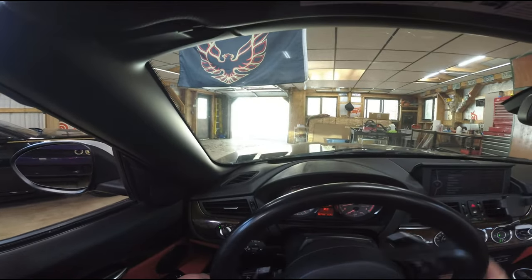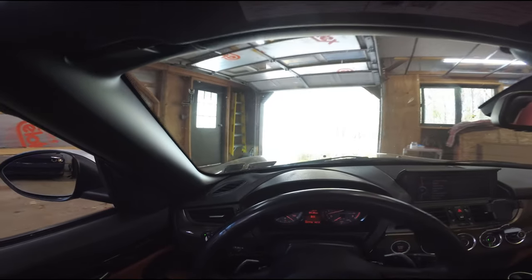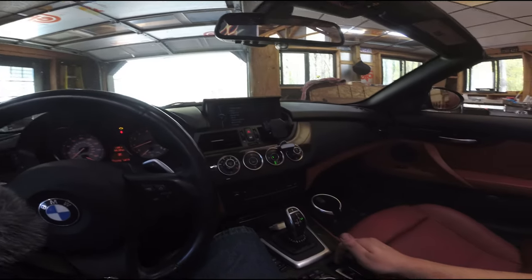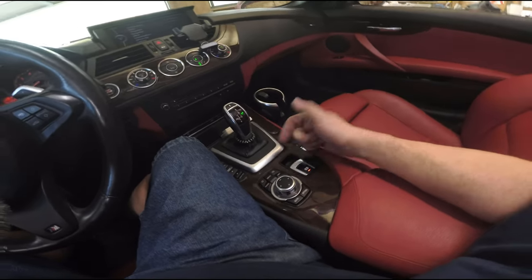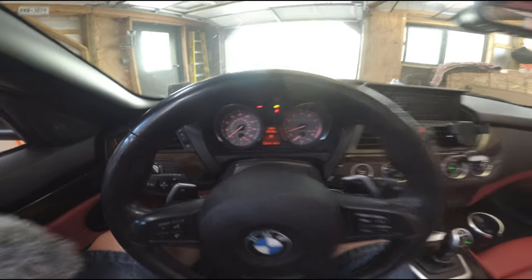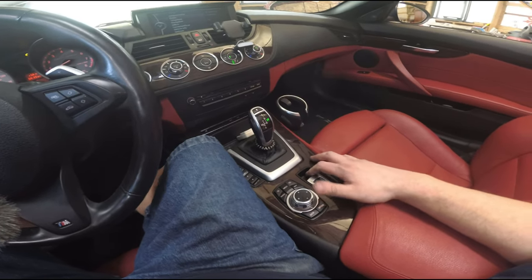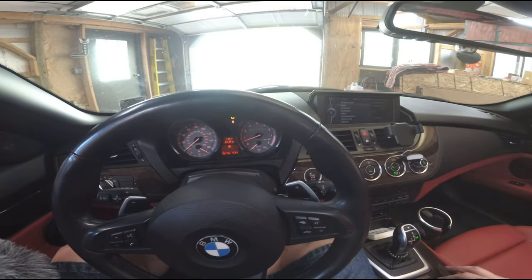The car's moving fine. Stopping really good. Put the car in park. Okay — I heard them. They actually actuated. I had to move the car first, put it back in park, hit the parking brake, I heard the motors go, lights on. I got a red park on the dash. Now I'm going to push it down — I hear them actuating and they're off. I'm going to do it again: they're on, I heard them go, and they're off. That's working great.